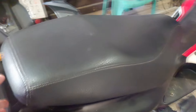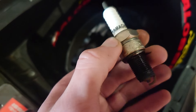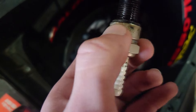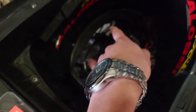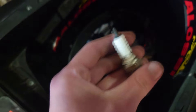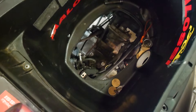First, look at this spark plug — this stupid thing. It's pretty common in my country because they don't know the basics of two-stroke. They just put in whatever spark plug they have. For this 50cc Piaggio you need a BR9S — they just put in random trash. This is like a 6 or 7 heat range, which is crazy that the bike doesn't seize.